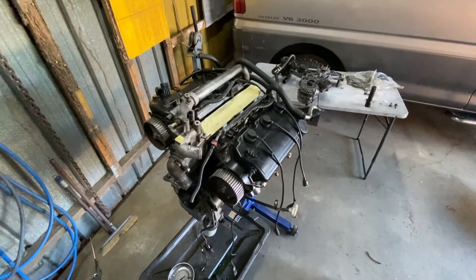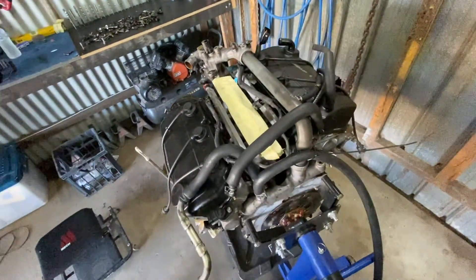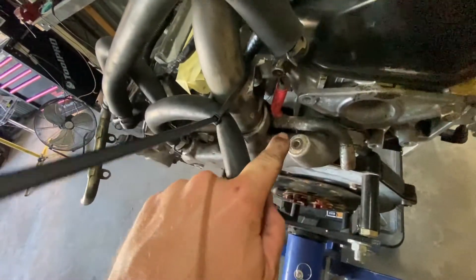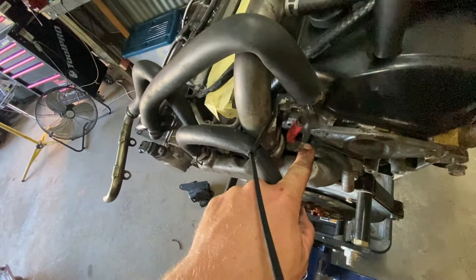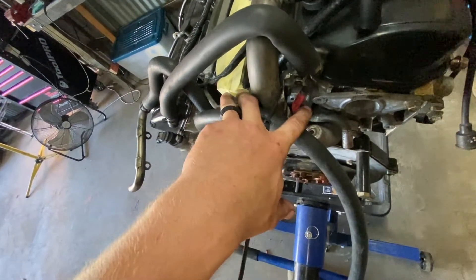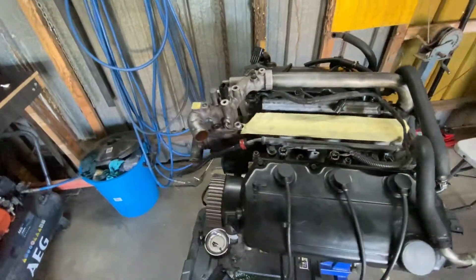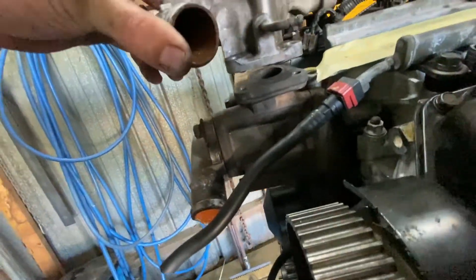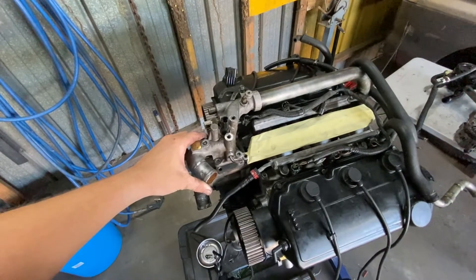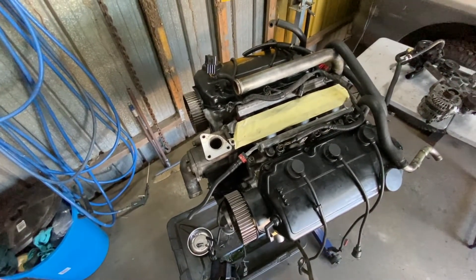Sorry, I think my phone died, so I'm just going to quickly cover those few bits and pieces. We've got most of the upper engine back together — if you've been following along you'll have a pretty good idea of how it all goes back together. On the right side, remove that tab and don't do that bolt up because you'll need to bend it out of the way to clear. When you reinstall your crossover pipe, you're going to need to notch a bit out of the bracket to get a hose on there. I have my fuel rail in. The upper part of the thermostat housing needs a 25mm spacer to sit flush — I'm having someone make one up, but the Delica Garage guys sell them commercially too. I'm not affiliated with them but they've been super helpful.